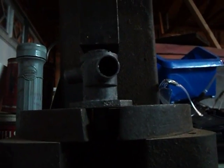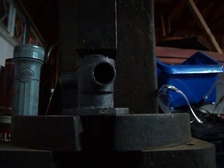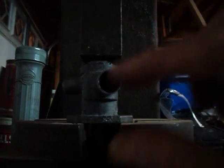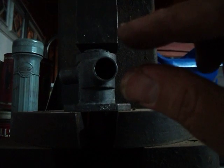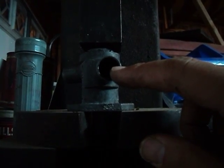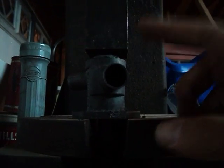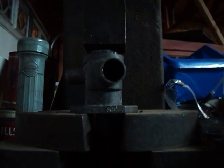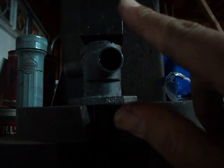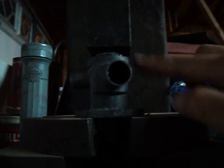This is exactly how it came apart. I can see straight through it right now, which is actually better than it was when I took it apart because it was partially obstructing the hole — it was so filled up with stuff. Once the RTV cures, I'm going to boil a cup of water, put it in there, and this thing should push the plunger all the way up to completely seal the tube and prevent any air from going through.